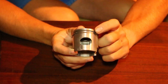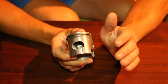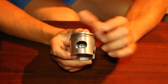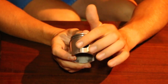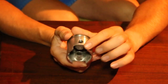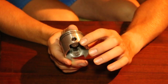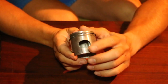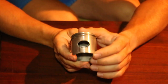Before I put this back into the motor, I'm going to take the rings off — which I should have done in the beginning — and make sure no metal is in there. I'm going to use the air compressor and really blow it out nice. I'm also going to take a file and just very lightly get any burrs off of here and on the side skirts as well on these edges. There's just a little bit — I know it's not going to be any kind of deal breaker for a motor like this, but why not get it as best as I can since I do feel a tiny bit of burr on some of these sides.